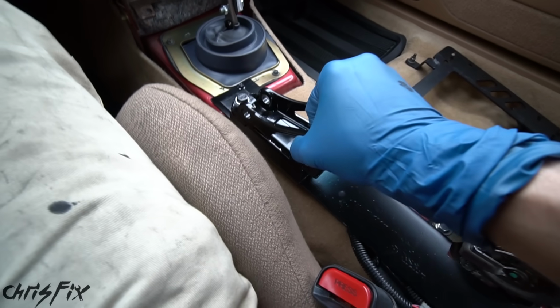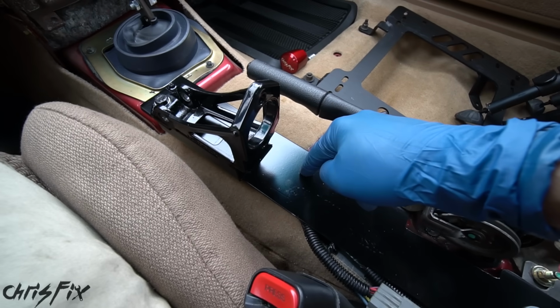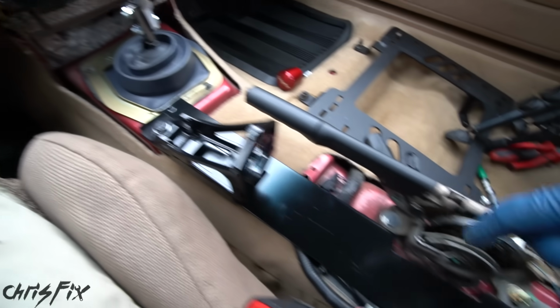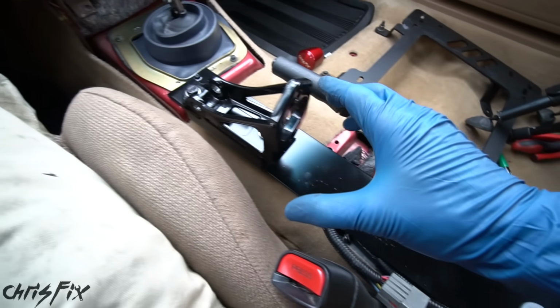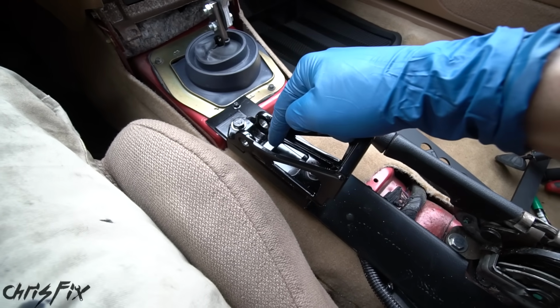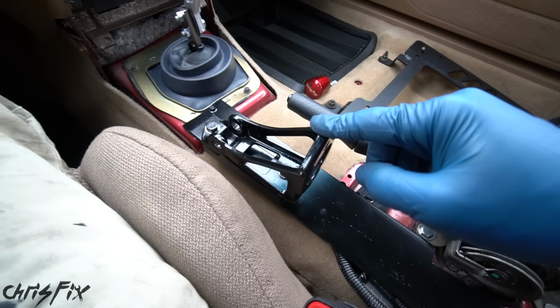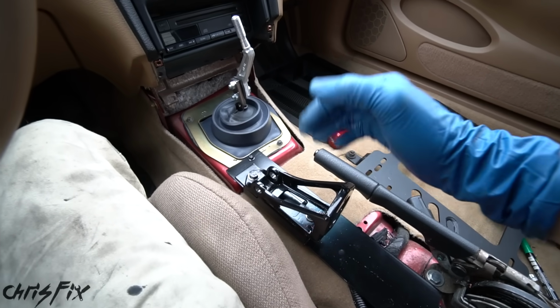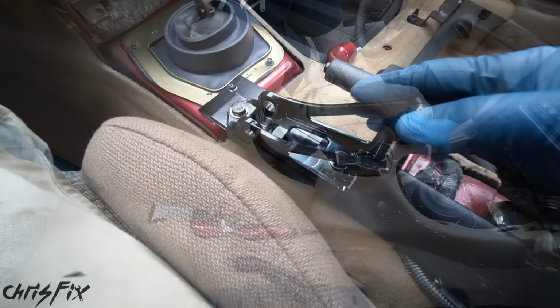And with both the bolts in, let's go test this out just to see how strong it is. Oh man, that's not budging at all. So that 3/16 of an inch steel is perfect for a nice solid mount with just 2 bolts. I thought I was gonna need 3, 2 work perfect. Now, let's get our hydro in here, then we could run our brake lines, and then we could go and test it out on the track and see if we could lock up those rear wheels. Man, this is exciting.